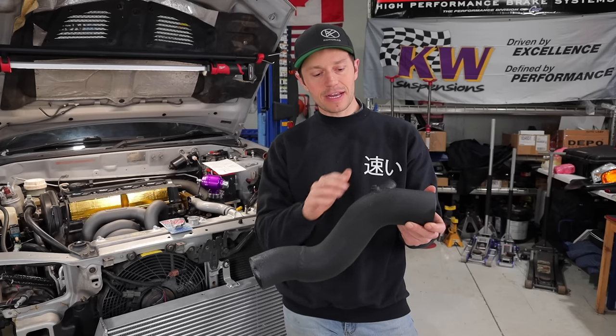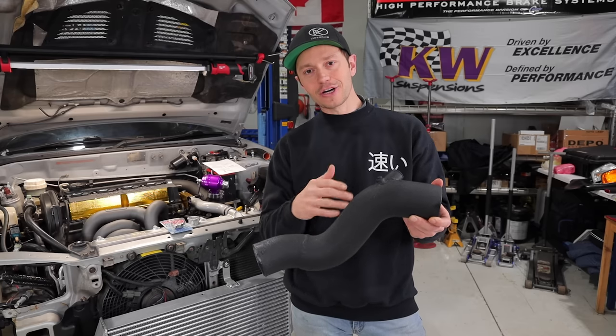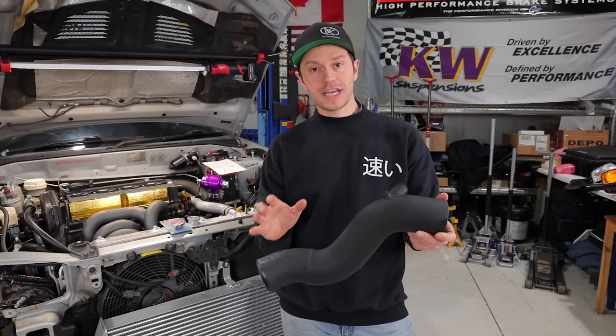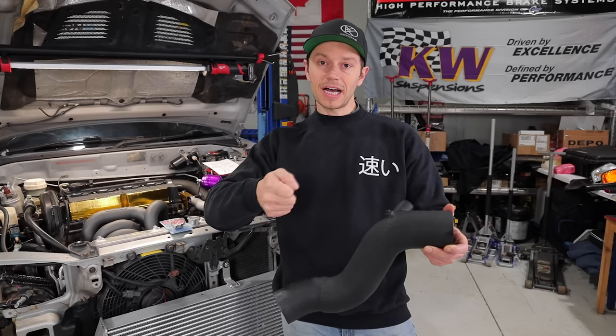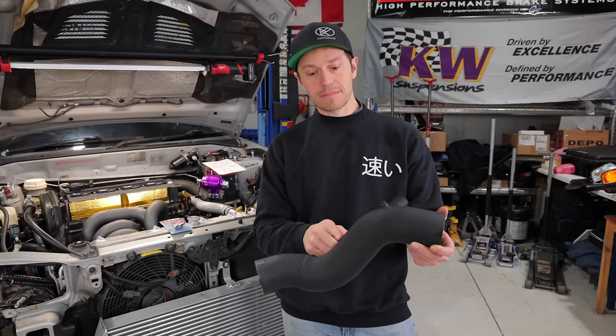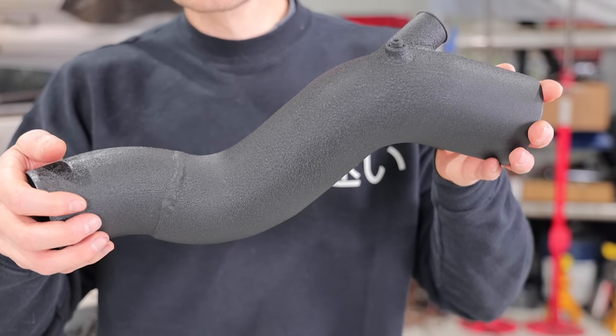What I did, the mistakes I made, which is why it was runny, is I let it air dry and I used too much paint on it. So a lot of you said the best thing to do is actually lay it on, then use a heat gun to dry it, and it'll wrinkle up much nicer than it did before. And as it's done in this area right here, it's looking really good.